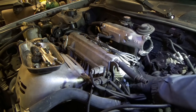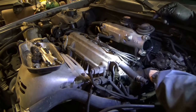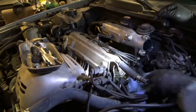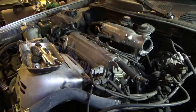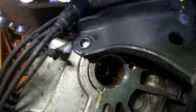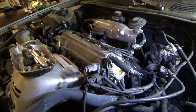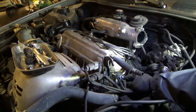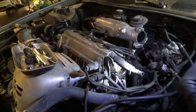I don't want any shavings or garbage falling inside the engine. Now I'm not sure if Toyota used to have a distributor here — I know the older Camrys from the early 90s had a distributor here, but now they just have Waste Spark on this model. Even the camshaft is splined for a distributor — you can see in there. So the head is the same; they just said hey, we don't need a distributor anymore, we'll use the electronically controlled Waste Spark system, which is more reliable. The distributors on those things do seem to go, and the igniters as well — those can be tough to find replacements for.